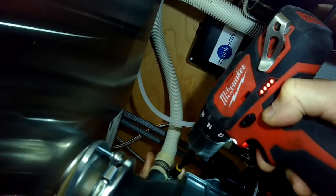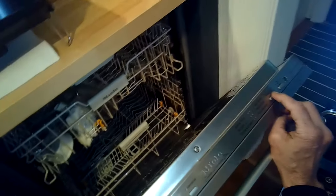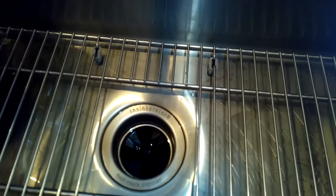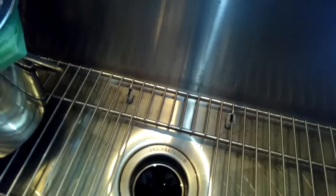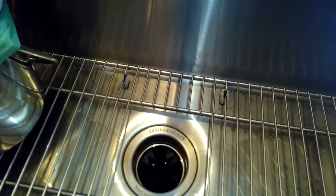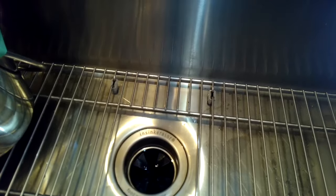We go ahead and tighten that hose clamp. You never want the drain hose to go straight from the disposal right into the dishwasher going down — you always want it to go in an upward arc. We set it for a new cycle, close the door, and we get good drain action. That solved our drain problem — no more intake/drain light. Super easy to do and doesn't take any parts, just a few tools and a few minutes of your time.